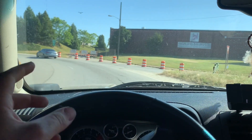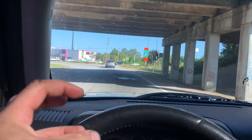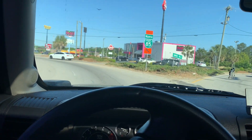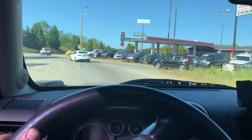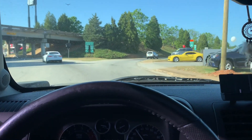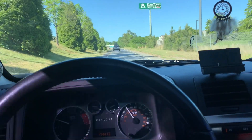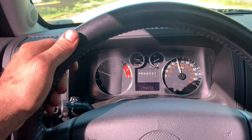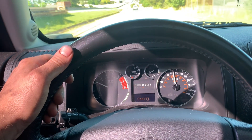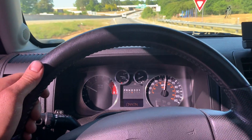Instead of the torque converter slipping as you accelerate, it would lock together with no slip — direct drive — and that part was not working. I also noticed that the new torque converter they sent this time is significantly smaller by comparison to the one they had me install the first time, which did work — but here's your sign. So TCC is enabled at 40 miles an hour, and we should see it engage somewhere around the 55 mph mark.